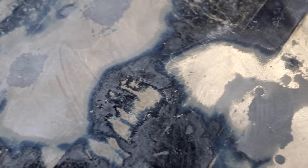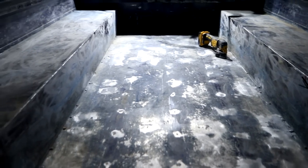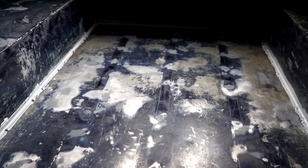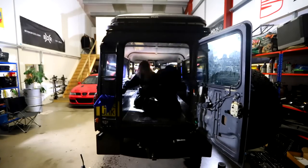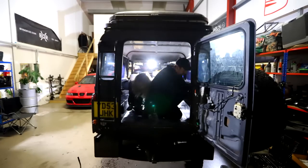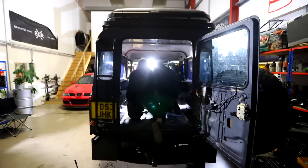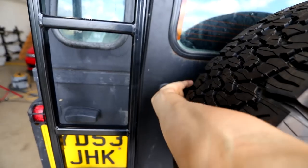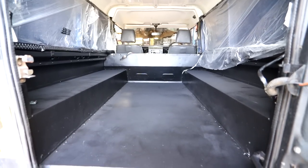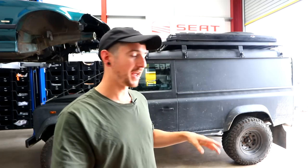Some holes had little pinholes so I went over them again. Filled all the holes — took ages. Then I thought I should put some silicone sealant around the edges, smoothed it all out. It looks a bit rough but it'll do the job. Then me and my girlfriend Ali spent all night painting. I used Hammerite direct to rust but it went a bit glossy, so the next day I masked everything off and went over it with matte black spray. The final result looks pretty sick — no holes, completely painted.